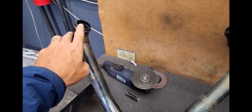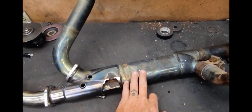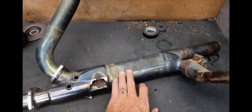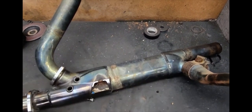There's a ton of oil in my primary tubes, and this is a catalytic converter that's also full of oil. So all of this — if I tried to start the bike, this whole cat is gonna melt and seize.